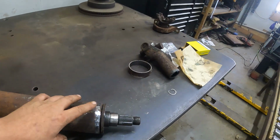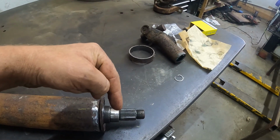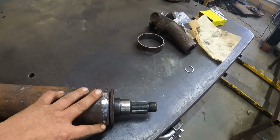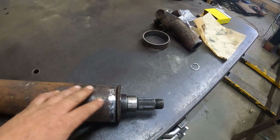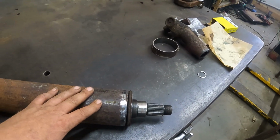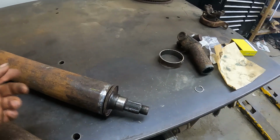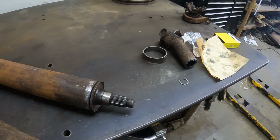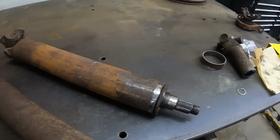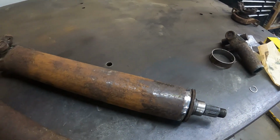By the way, if you want to see a video on shortening up drive shafts, I made one a long time ago. I'll put a link in the description for that on this video. They can check that out. It's really easy. People always say you've got to balance the shaft and stuff like that. If you use the original tubing and everything that's original and you just shorten it up, I wouldn't worry about it too much. I've done it plenty of times and never really had any issues with it. No vibrations, none whatsoever. So like I said, if you want to check that video out, it's in the description underneath here, and I'll put a card at the end for that video as well. So anyway, let's put this drive shaft back together.